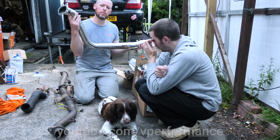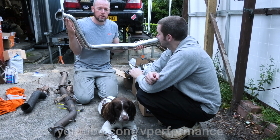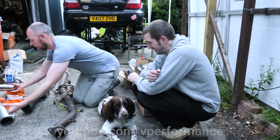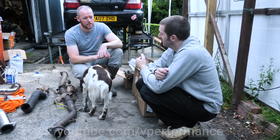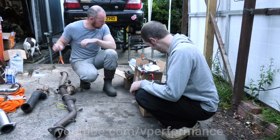Because they're going to moan that's not where it's supposed to be. Okay, if that's not the place to put an exhaust gas temperature sensor, the only other place I can put it is literally in the turbine. In the up pipe? Yes. Well, we're putting it here, because there's a hole there already. And should our shitty exhaust temperature sensor fall to bits, it will not then be sucked into the turbo. Yeah. It'll be blown out of the exhaust, ejected out the back through our not heat wrapped downpipe.